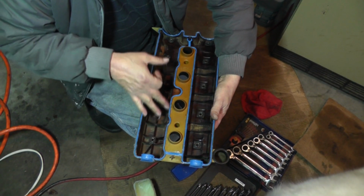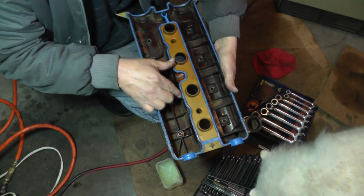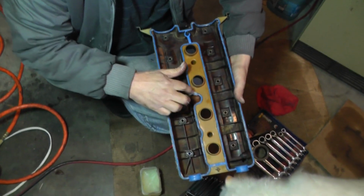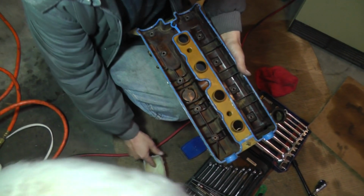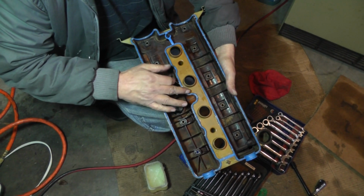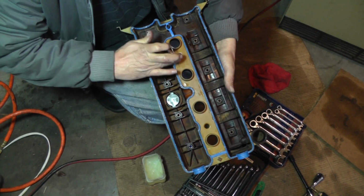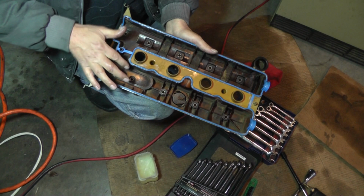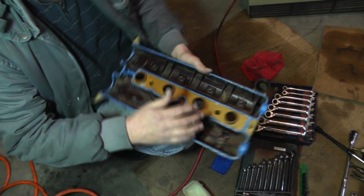So, is it possible that the bolts could actually bottom out and hit the bottom of the hole before the torque is even reached, which is 71 inch-pounds? I would think so. So what I'm going to do is I'd like to get say about another 1/8 of an inch in there. So that'll give us a total of 1/4 inch, okay, 1/4 inch for the bolt. That should take care of us torquing this thing up, making sure that this gasket is actually going to seat.